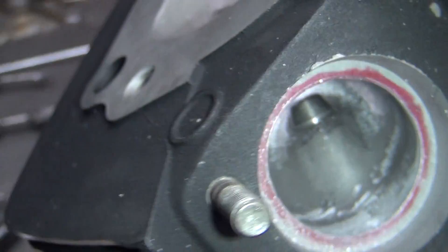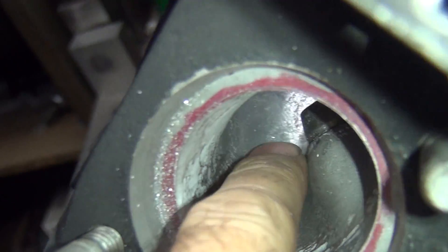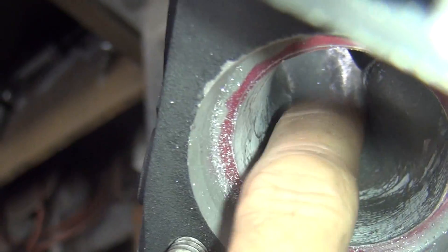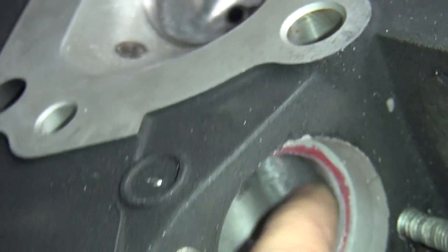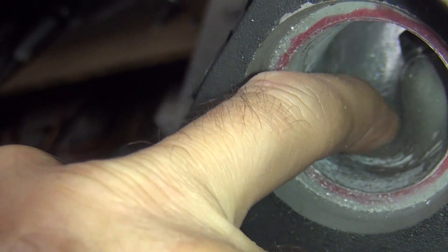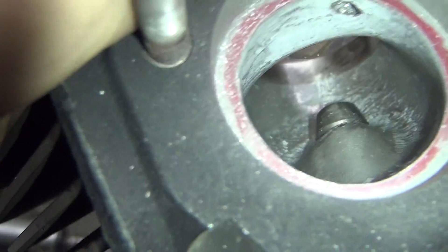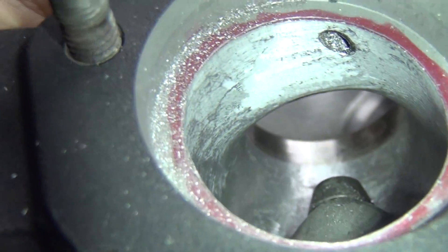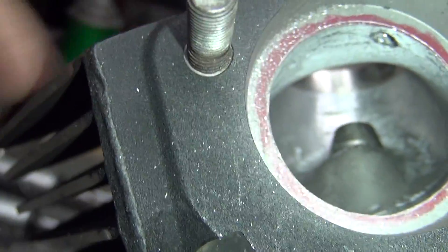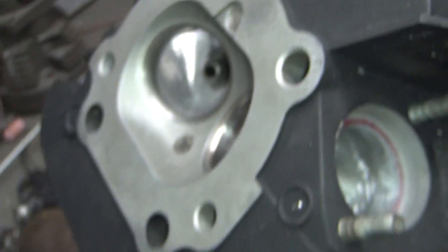I'll just touch this up and finish it. I only spent a couple minutes there — it didn't take much. They're pretty smooth already, so I just knocked off any little casting flaws. They're nice and smooth all the way through. It's pretty deep through here so we don't do anything with that. You can see now you can get some good clearances up through here for flow — it's nice and smooth, with room on both sides of your valve guide flowing pretty equally. These are pretty good heads to start with. Anyway, this one's done, so I'm going to go ahead and move on to the other head.